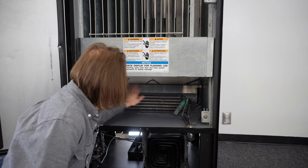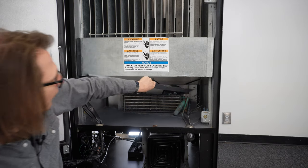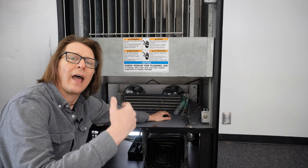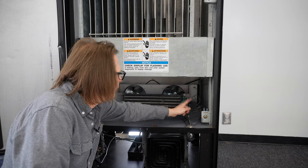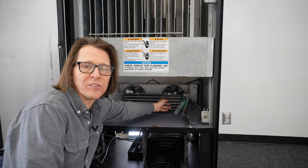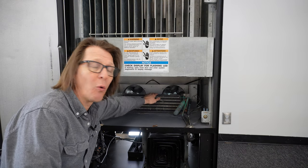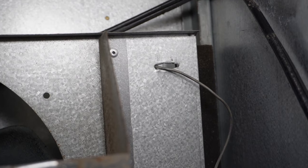Now I'm going to remove the clips that are holding the cover on the cold box and pull it out of the way. Here you can see the actual temp probe or capillary tube going into the back of the cold box. We always want to read the temperature as the air comes off the evaporator coil. If you purchase a used machine and the temp probe is stuck into the evaporator coil itself, that could cause cooling issues because the coil core is always colder than when air is being pulled off of it. We always want to read the temperature after the evaporator coil — on this machine there's a small hole on the right-hand side where we can stick the capillary tube to read the temperature as it comes off the back of the fans.